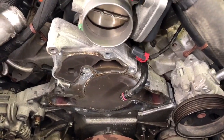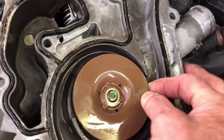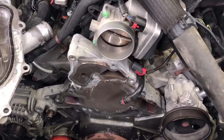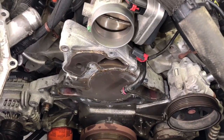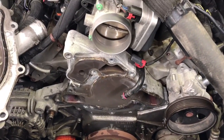There you have it — one water pump removed. It's definitely bad. The bearing in there is shot; that thing shouldn't wiggle like that. That's where the noise was coming from. It's funny — they don't look like they used to; it doesn't even have a weep hole in the bottom like the old school pumps. Alright, now to get this all cleaned up and get it back together.